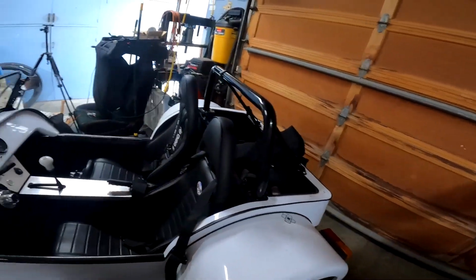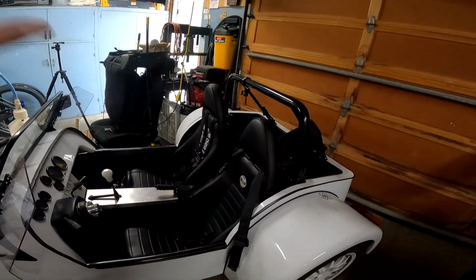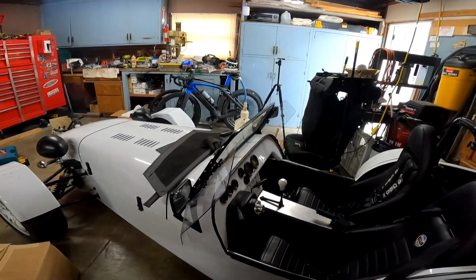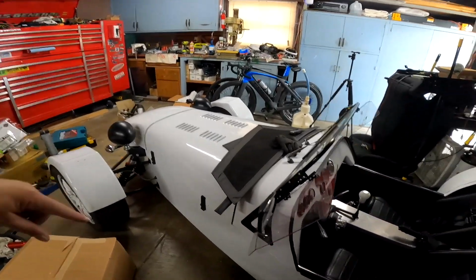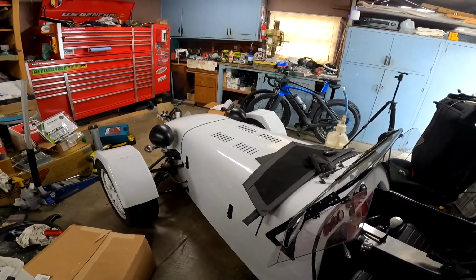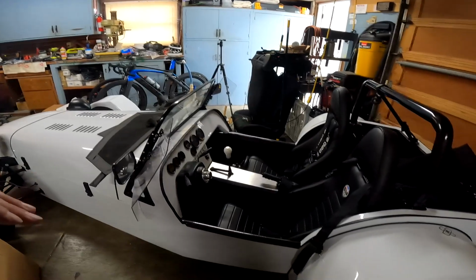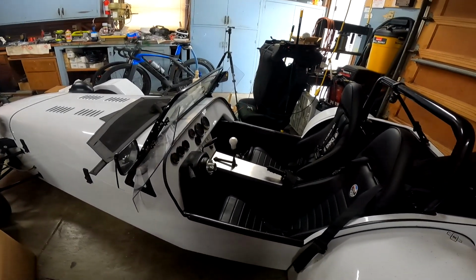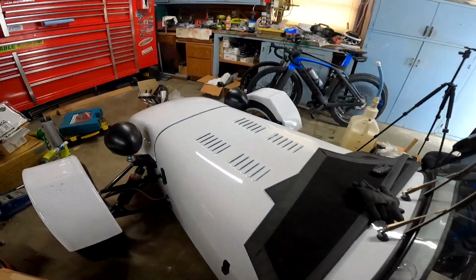It's super addictive. I cannot say that enough. The sounds from the ITBs, now that it's been tuned, just the rock solid torque from about 4 grand up is amazing. Since we have it tuned on the dyno, I've come back now and reset the idle and rebalanced the ITBs now that we have a good clean idle signal to start with. And it is much, much happier when cold, and idles a little bit higher when it's warm. Again, it's done with the lumpy idle that you might hear in some of the driving videos to a now more steady idle. But because of the big cam, that idle sits at about 1,000 to 1,100 RPMs. And that's just big cam problems.